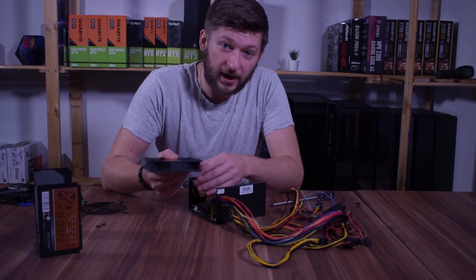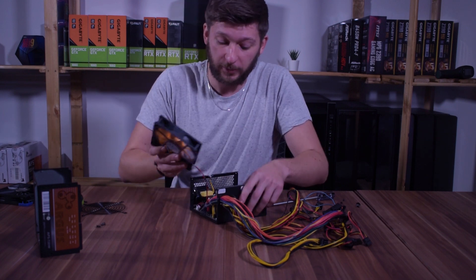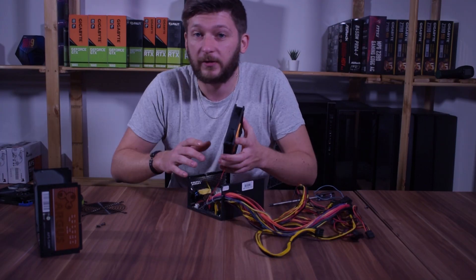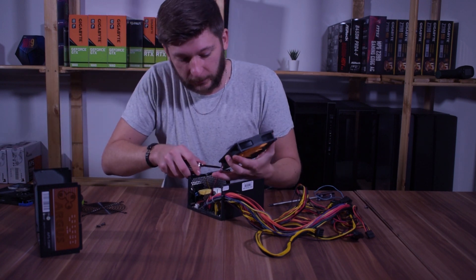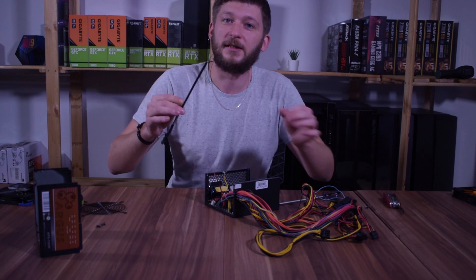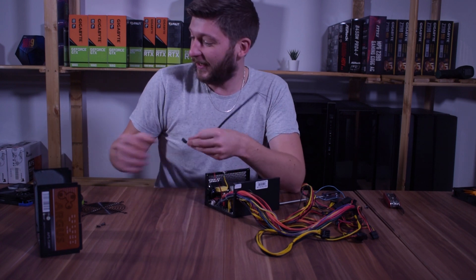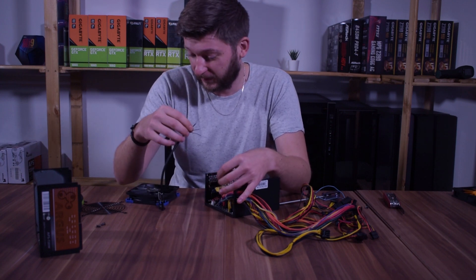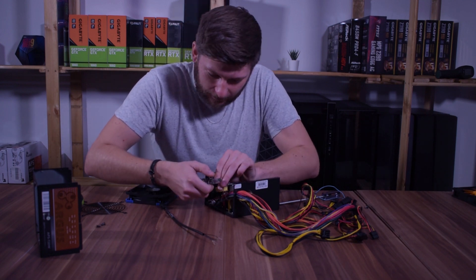So now we have removed everything and we ended up with these two little wires and a 2-pin connection here, which is glued down to the PCB. I don't have to rip the connector off because I don't have an adapter anyway. What I will do is just cut those two cables and use my PWM two-wire adapter which I prepared, and just connect the Noctua fan, then play around with the cables until the fan starts spinning. Please don't repeat this — this is not the most elegant way to do anything.